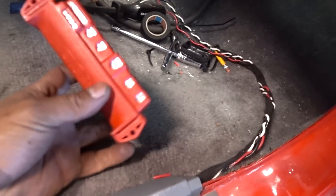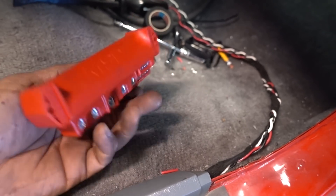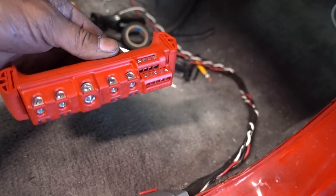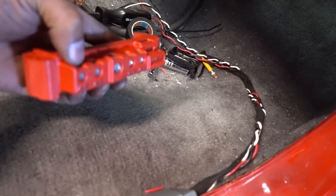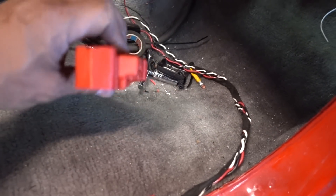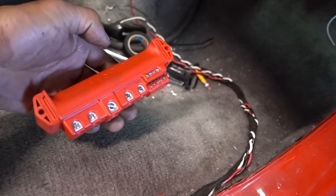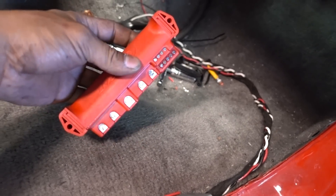Alex made this nice little plate to hold all our stuff — battery tray — that's all in there, underneath the dash. Instead of just having a big ol' clunky fuse box and relays, we're using this: an MSD solid-state relay. This is four relays in one — power goes in here and these are your outputs. Super easy — I've used these a hundred times on different cars and it just makes wiring a car way easier. Less wires, no fuses, solid-state relay, never goes wrong.